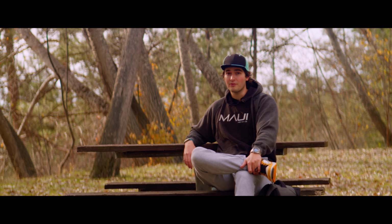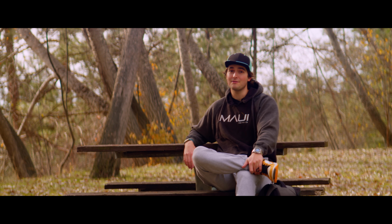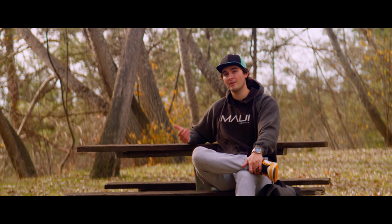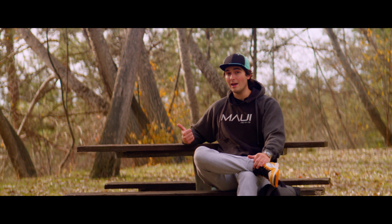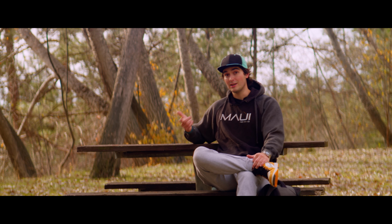Now in hindsight, we could have gotten away with something like 3mm spacers, but I went with 10 because I figured that would be a lot easier to reuse in the future on future projects than something as small as 3. This, however, will be enough of a difference to A, make it look a lot better, and B, stop it rubbing in the rear, which is the main benefit. The real question is, however, does it look any better?